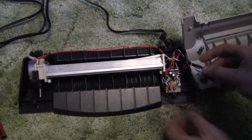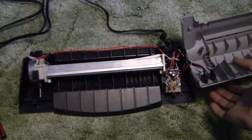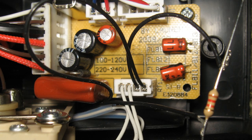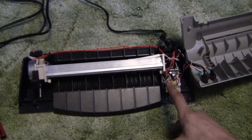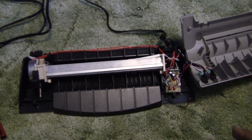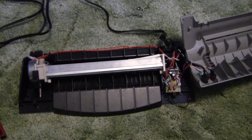Here's what I did as a temporary solution. What I want to do eventually is put a switch on the front panel of the gray part, but I'm still waiting on a switch. Cut one of the black wires and put a 1.2K resistor in line with it. I just stripped the wire and wrapped it around quickly as a test, and it does work — it raises the temperature to right around 148 to 150 Celsius, which is right in the ideal range for toner transfer.